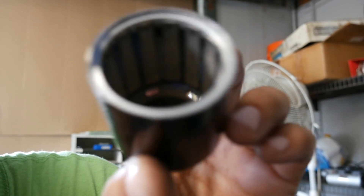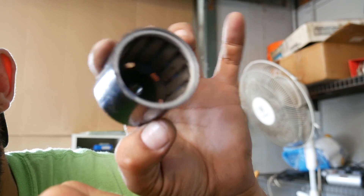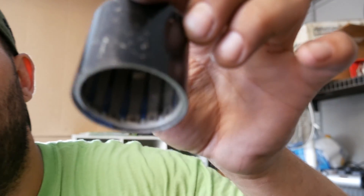I wanted to touch base on motor failure and it getting hot and melting. If we look at the inside of this motor, I don't know what this blue material is that was used, but you can see it did get hot and drip down into the bottom. See it there — where that blue stuff on the edge dripped down. When this motor came apart it was pretty fresh destruction, and this is an Evolve motor here. When I pulled it apart that stuff was gooey and you could tell it had a lot to do with the motor failure. Now it's rock solid.